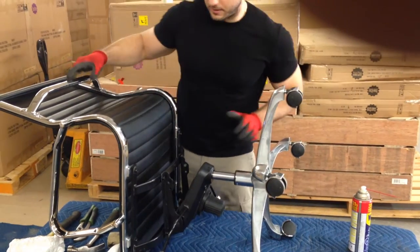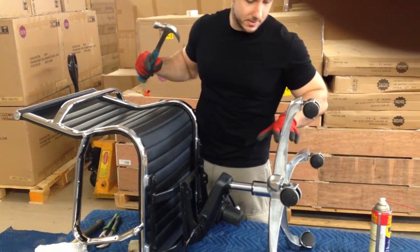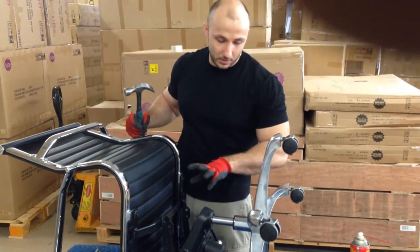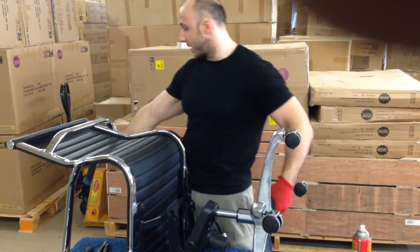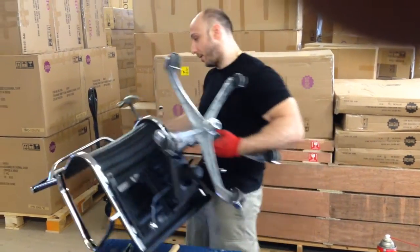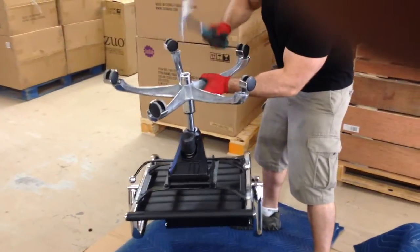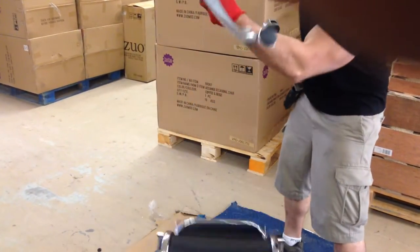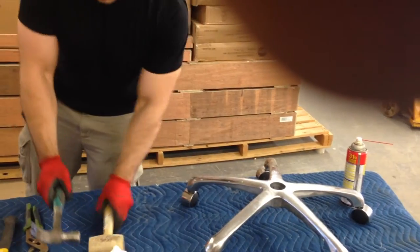What I like to do is use a hammer to hammer out the piston and base. Sometimes the piston will continue to stay in the base, or the piston will just fall off with the chair completely. That's why I set up a little carpet section right over here. We're going to get some light taps at first — and there we go. So now we have the piston out of the base.